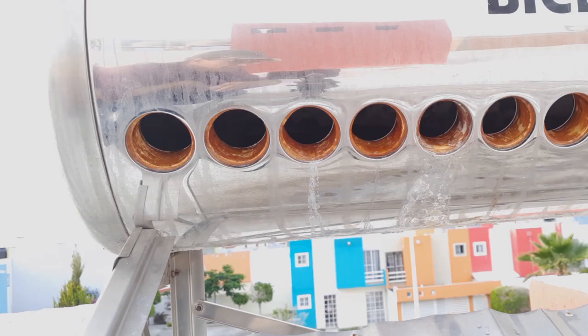Back to the tank where I've already removed the old silicon seal rings. They were easy to remove — just grab them with your fingers and pull them out. Some of them may stick a little due to dried scale. After they have been removed, put your fingertips on the inner side of the tank holes and remove any scale present. It should flake off easily.